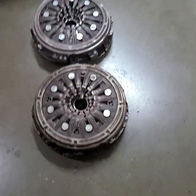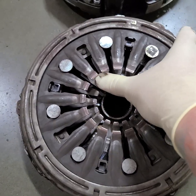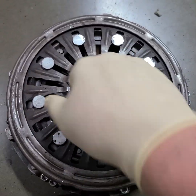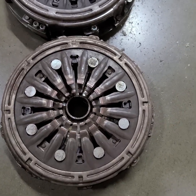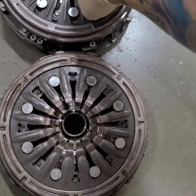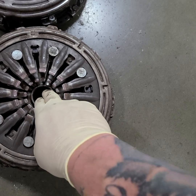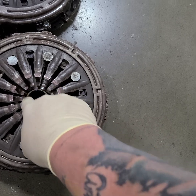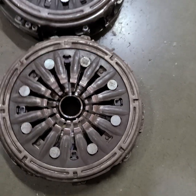You probably have about a finger's worth of clutch movement - you can fit a thumb in between that. There's not a lot of room between these to go through and start pushing down more. There are also issues with the inner clutch: you can't push too far down on the inner clutch because you will start making contact with the inner clutch hub.